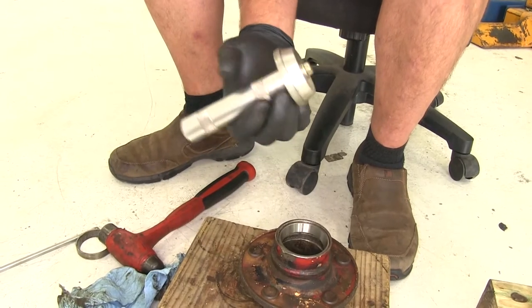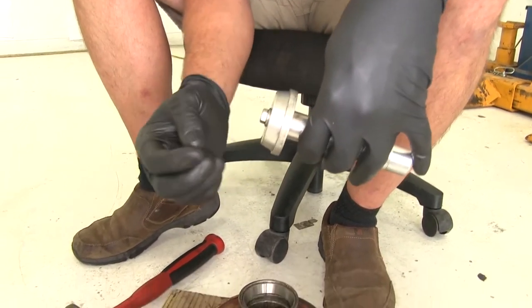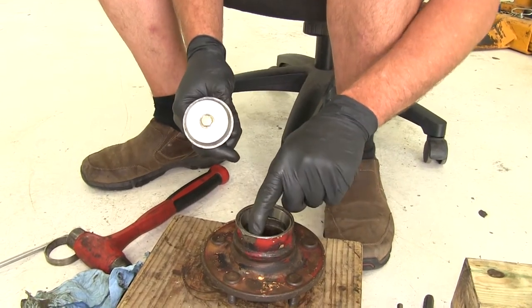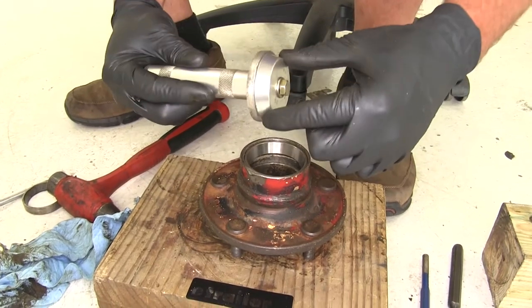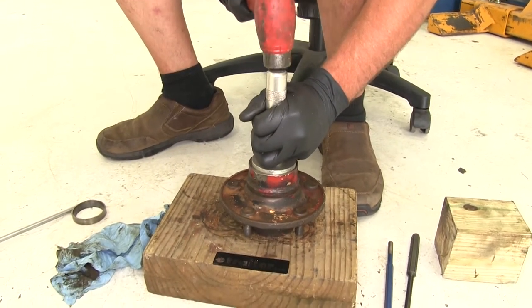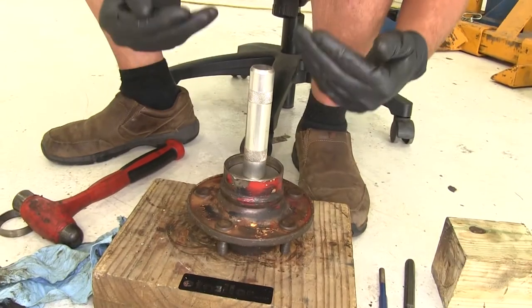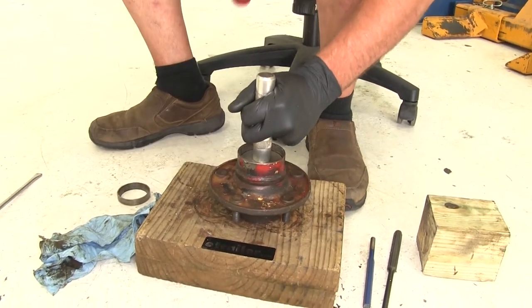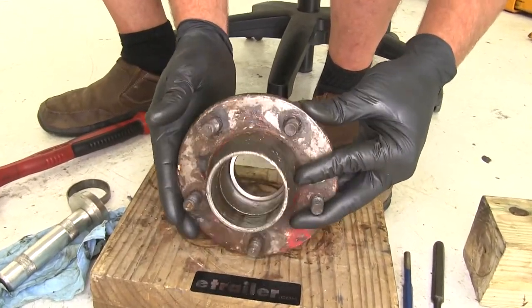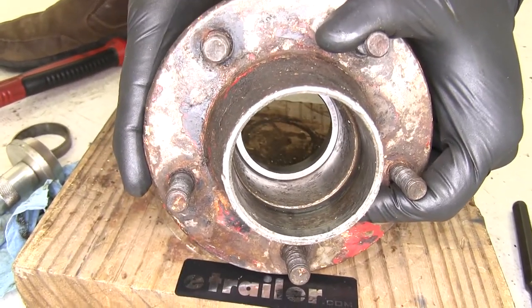The second method is our race and seal driver kit. This is from Performance Tool — part number PTW83020. It comes with many different size heads for many of the different common size races and bearings. This takes a lot of the worry out that you might potentially cause damage to your new race as it goes in. You can see it's got the perfect taper — it's designed to fit that race. Then it's just a matter of driving it in with your hammer. As you go, listen for the sound to change: it goes from a hollow sound as it's moving to a much more firm sound. Right there. Now flip this over and check around the back side of our race to make sure it's all the way down against that seat. Now we're ready to do the other side.